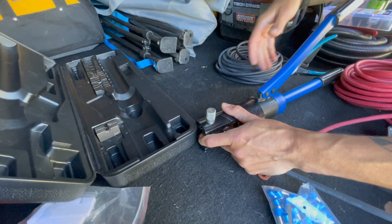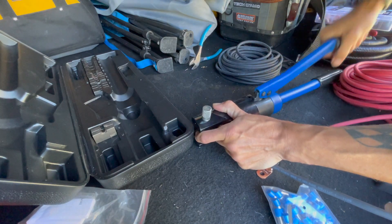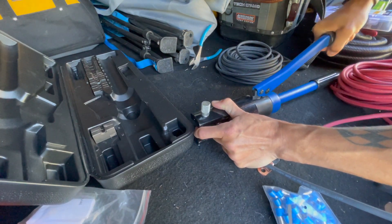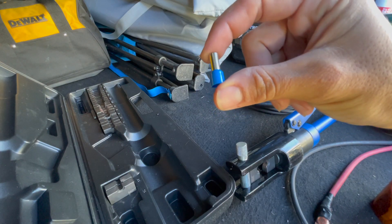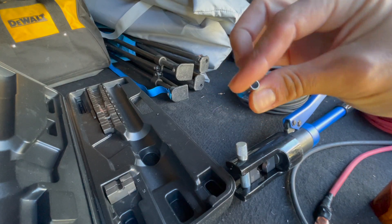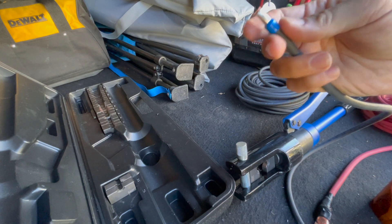In case you haven't seen my other videos, I have this hydraulic crimper. I got my lug loaded in here, my wire nice and tight, and I'm going to go ahead and crimp this down. I'm not going too in-depth with this since I show it in every single video — it's really not that difficult. On one end we have a regular lug, and on the other end we have these pin connectors. It does technically take a special tool to make a nice square tip, because the Victron charger uses a square insert.